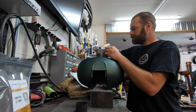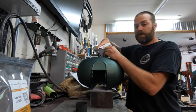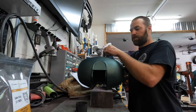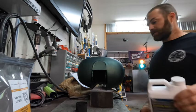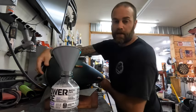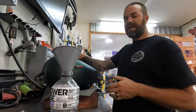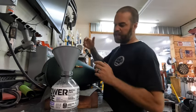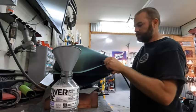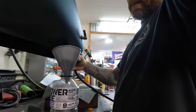In it goes. When the magic happens is when you empty this out and rinse it out and dry it — you're going to see how that surface rust inside is all gone after this. We've got this all in there, capped it off. Several hours later, this thing's been swished, swirled, and rotated. This is our surface prep: we've rinsed it, we've degreased it, now we're on to the third step — which is basically an acid etch. We rotated it every half hour so every side of the tank has been coated. Now we're going to drain this off. I expect to see a little orange tint to it.